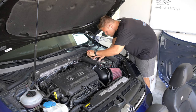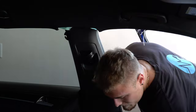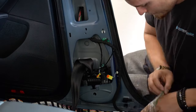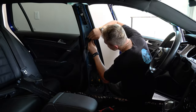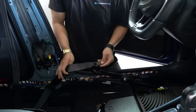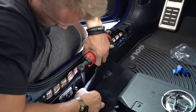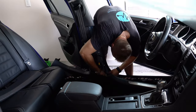To install these seatbelts back into the car, I first need to disconnect the battery, as I don't want to accidentally detonate the charges that were just replaced in the seatbelt during install. Getting the trim out of the way reveals where the seatbelts need to be mounted. I plugged the detonator switches back into the correct spot by matching the colors, then strung the seatbelt through the mounting points and trim using the bolts I'd left in place, making sure to bolt down all the guides correctly. Then I reattached the seatbelt to the pretensioner using the clip, bolted the pretensioner onto the carpet, plugged everything back in, reclipped the wiring harness, cut the zip tie that prevents the seatbelt from tightening during install, and put all the trim back in place.